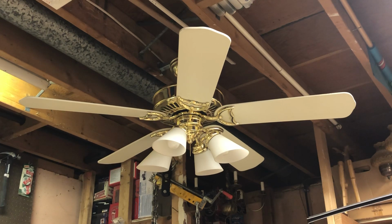But I can tell you right now, the build quality of this fan versus the original Panama 2 is definitely a downgrade. Everything's stamped steel instead of cast parts like they do with the motor housings and the switch housings and such. But this is still a decent fan nonetheless. The fan uses a 188 millimeter motor. The blade pitch, I would say, is around 13 degrees.